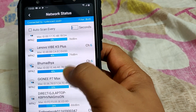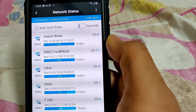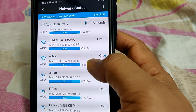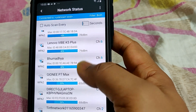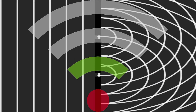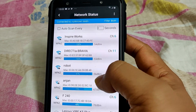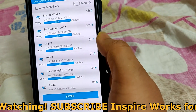My Wi-Fi router is currently using channel 6 to broadcast the signal, but looking through this data I was surprised to find that more than five other Wi-Fi routers are also using channel 6. This is creating a big problem — their Wi-Fi signals are interfering with mine and making it weak. The more users on the same channel, the weaker the signal strength and the less speed you will get.